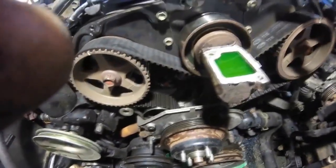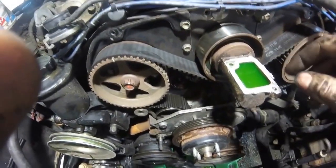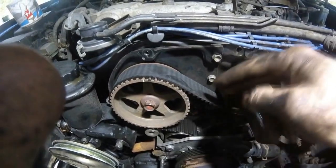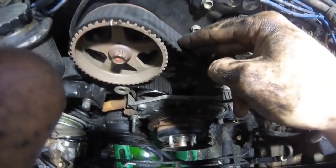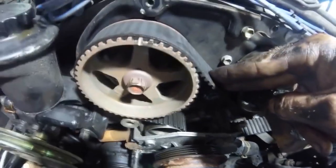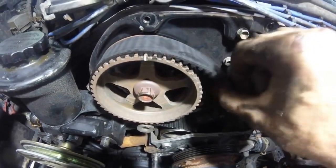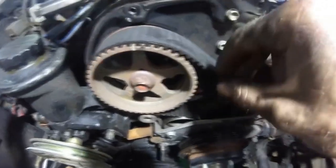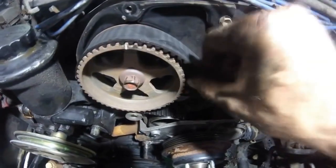This is a good opportunity to inspect the condition of the timing belt tensioner, belt, water pump pulleys, and things like that. I'm going to push on the belt — you can see we have tension right now, which is good; you shouldn't really be able to push the belt. Now I've just pushed it with my fingers barely and it's moved the tensioner — you shouldn't be able to move the tensioner with your fingers. The belt is now all loose and flopping around.